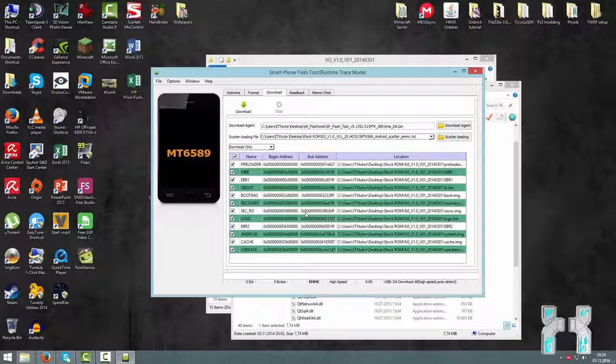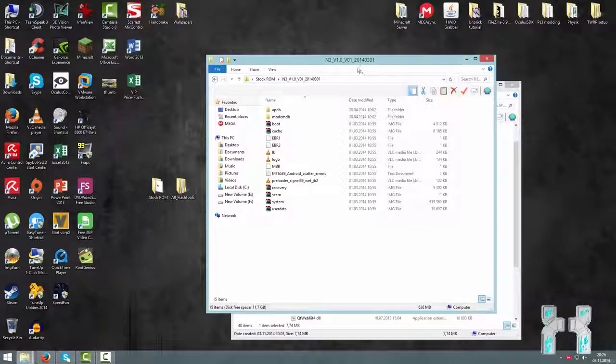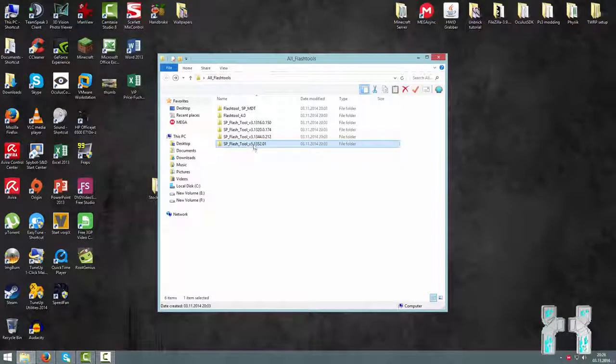After that you should be able to boot if the ROM was correct. If you get an error code in SP Flash Tool like 4032, that usually means wrong ROM. An error like 8032 is usually a driver issue. Check the link in the description — I have some errors listed with their meanings. Also try different versions of the flash tool, going from the latest version 5 back down to 3.1. If you still have issues, post a new thread on Chinadevices.com and I will try to have a look at it as soon as possible.